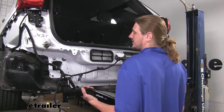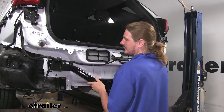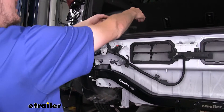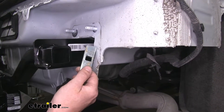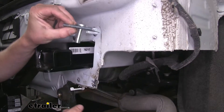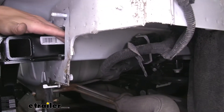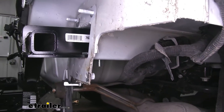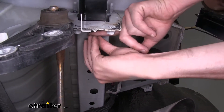We can now take our hitch and put it in position — it will slide into the bumper beam. Make sure not to pinch any of your electrical wires. If they're in your way you can pop them back up on the studs to keep the wires out of the way. We can now fish wire our hardware in. Rather than fish wiring the spacer and bolt as the instructions recommend, you can just take your spacer and carriage bolt, set it up together and slide it in so it drops down the rearmost hole in your hitch. On the bottom of your carriage bolt, place the conical tooth washer with the teeth facing up towards the frame, then place a nut on it.